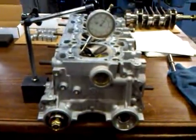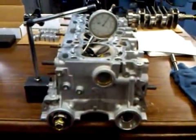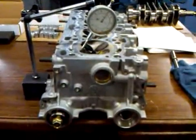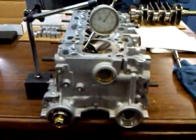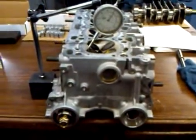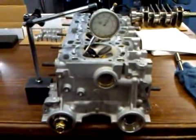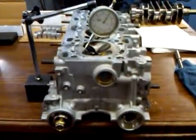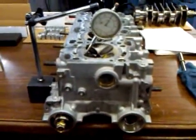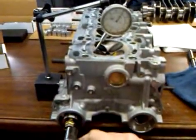So I'm going to go ahead and check it right now. We have the dial indicator on the mag base zeroed out on the exhaust valve face, and I'm going to roll the camshaft over. It's a hydraulic actuated lifter, so I had to take the lifter out and make a mechanical style spud piece that sits in there that duplicates the lifter's installed height. Now we're going to be rolling it over to verify what the valve travel actually is.